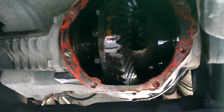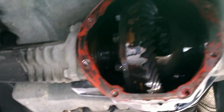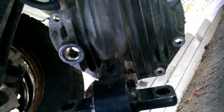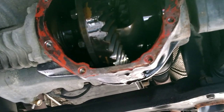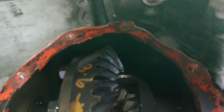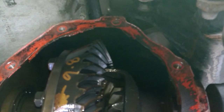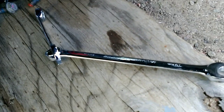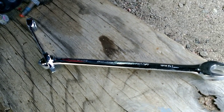I wanted to provide an update if you're going to be changing the sealant on the front differential cover. It's going to be 16mm fasteners holding on the diff mount and the cover as well. When you remove these two fasteners, you'll find that the diff drops down and you can reach the cover bolts. The top two are very hard to reach. What I did was lock a stubby 16 and a regular long 16 together, and I was able to crack the fasteners loose.